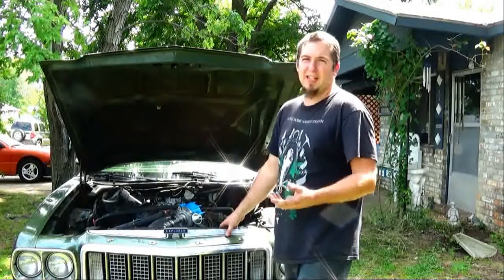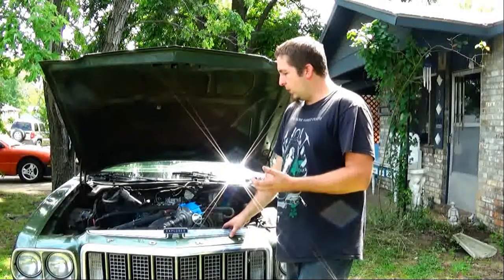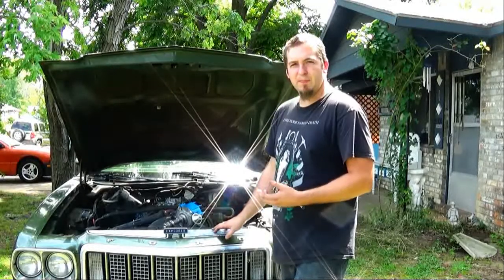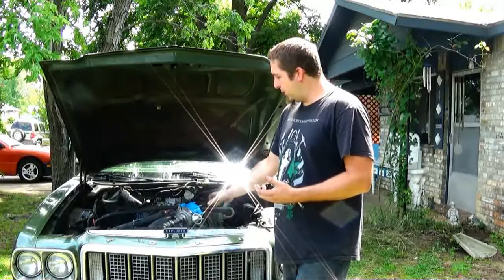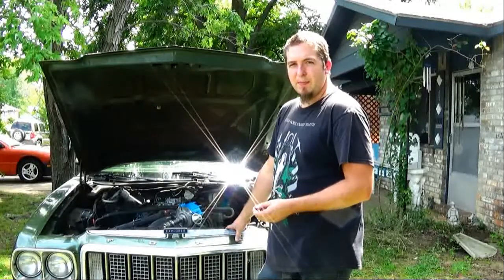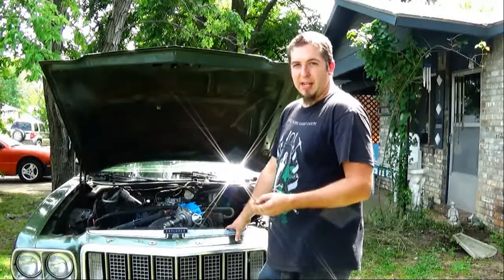He drove around the block, and the exact same thing happened. So at this point, I'm wondering what happened. I went over to the car, popped the hood, and tried advancing and retarding the timing while he was trying to crank it over, and we get the same thing every time. Now the distributor had not been out yet, so it seemed like it jumped time.